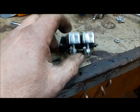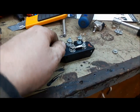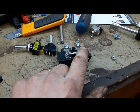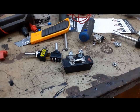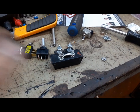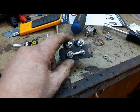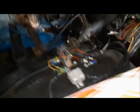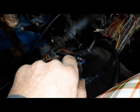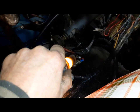Here are our breakers for the RV plug at the back. I found this little breaker holder in my junk — these are 25-amp breakers, which is what you want. One is for the charge wire to charge the house battery in your trailer, and the other is for the electric brakes. This is going to have a 14-gauge wire going back, so 25 amps is fine. Now we have to mount this on the fender apron near the starter relay so we can run a jumper over to it. Here are the circuit breakers mounted to the inner fender — I've got a little bus that I made to take it over to the second one, and the load sides are live.